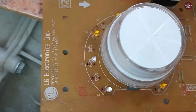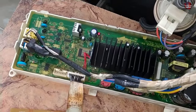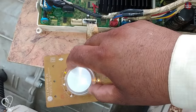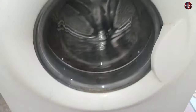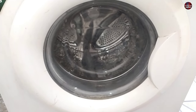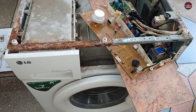Let's see how the motherboard works now in the washer. I have changed both these LED lights — they seem white in color but are the same orange colored LED. I have passed electricity to the washer. I press the power button and all the lights around the knob have turned on. I set the rinse function and press the start button — the washer has started to work. The drain pump has started, the drum is rotating in both directions, and the water inlet valve is also working fine. So as you saw, a single shorted LED caused this entire problem, which has now been fixed.